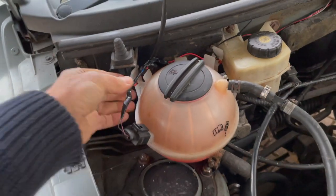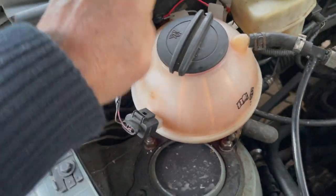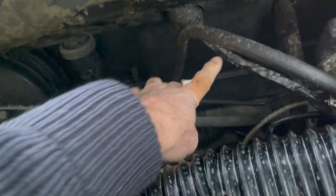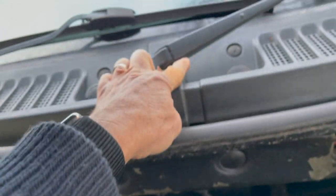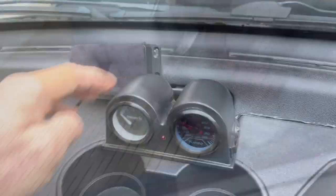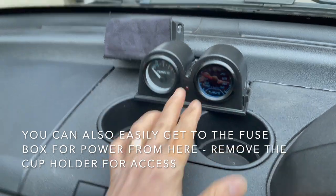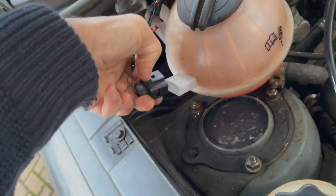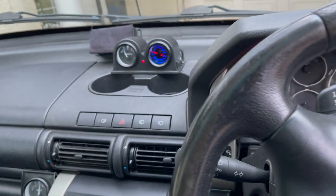That's the little module wired onto the tank. I've insulated it in silicone and insulating tape, and the wires run into the cabin for power and the LED light. I've taken several wires through the drain grommet at the bottom of the drainage channel — if you remove the plastic trim there's a grommet on the bulkhead leading to an area just behind the digital clock. I've placed the LED on my instrument cluster, that little light there. With the ignition on, the LED is off, and when I disconnect the sensor connection from the tank to mimic no water, the light comes on. So that's our low coolant warning light — thanks for watching and good luck with yours.